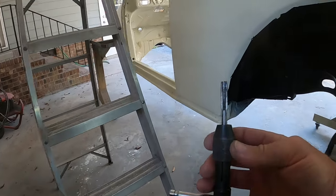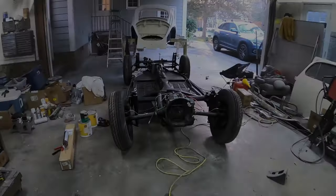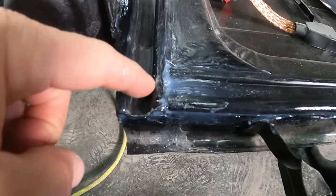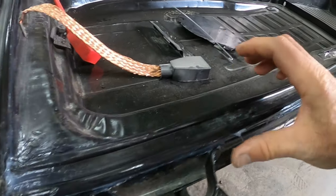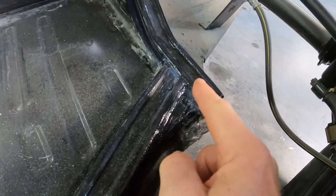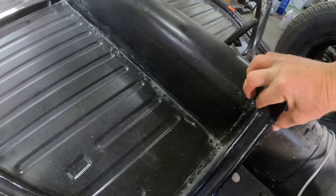I used this and tapped each of the bolts into the receivers so that I know it will fit. I'm preparing for the body install, which I'll probably do tomorrow. What I did is put the seal on here - you can follow this around. In the places where it joins and on the edges I put clear silicone. There is no way this is going to leak, at least not initially. I got the silicone on the inside and the outside going all the way around. I haven't cut the holes in it yet, but this meets up here with more silicone and comes up over here. Just making sure it's centered everywhere and sealed on the inside and outside.